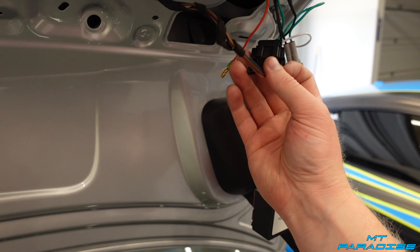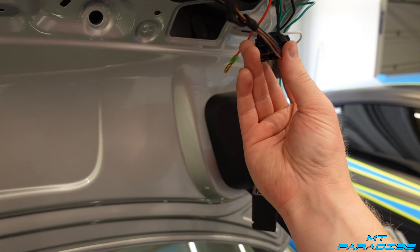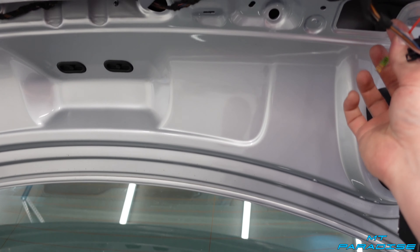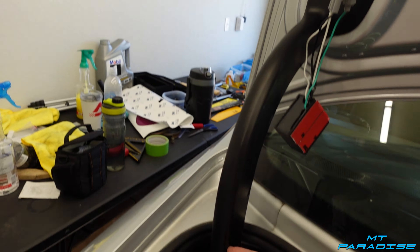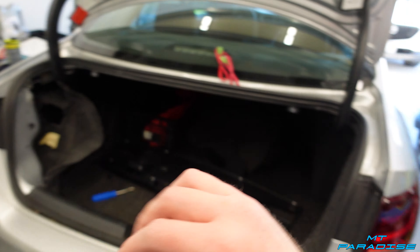Now I'm going to go ahead and put in the light from the hatch. I've already got it right here — I'll pull the plastic off and remove that clear film. Now I'm going to pull this down and just like before, take everything through the hole first, then set it into place. Keep in mind when you put this into place there's a plastic trim on the outside that has to hook on the outside of the metal body itself. Hook that over top first, then line up the screw holes, and it sits right in place. Then open it back up, hook in the two screws, and get it plugged in.